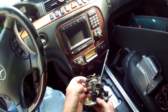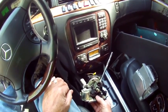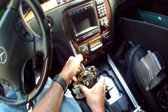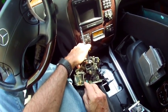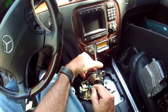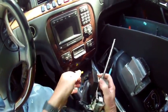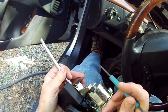The solenoid is activated and it lifts up on our original OEM plastic arm, which can break right there - that's why it wouldn't shift. Brake pedal off. Once you depress the brake pedal it lifts this arm. Let me get it out of park. When this arm lifts up, it's hitting this little pin, and that little pin is actually on this other arm back here. That other arm we have to unplug now.